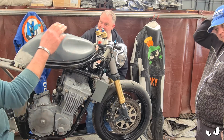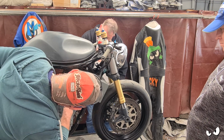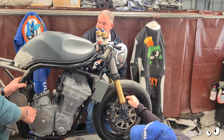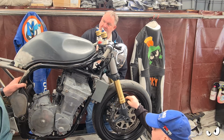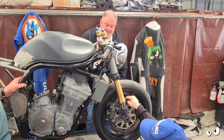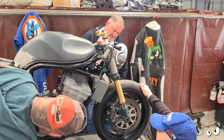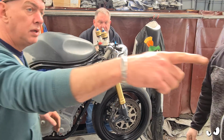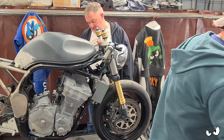He is very knowledgeable. So, the oil cooler currently hits the wheel. It needs to go up. Is that a good thing? Because that puts us above the cam ties and stuff. And that's where the galleries are, where they've got the two bolts at. Yeah, but there's the height of where the oil cooler is. That's an important thing. That one is a really deep oil cooler. The stock one went there, but you've got stupid forks on it. You're not going to get it much higher, are you? What did you have left there? 40 mil? Yeah, about that. Did you measure that? No, I just got it off the tire. Right, where's the rule? Measure that and we'll see how high you need to go. Rules up there. It's a square. On that? Oh, where's it gone? Oh, here we are. Yeah.